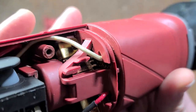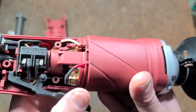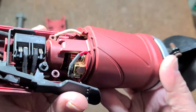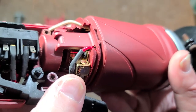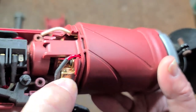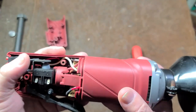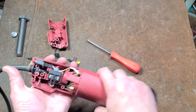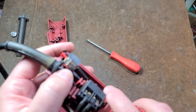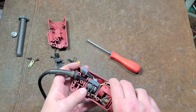The motor is not particularly great — we can see it has folded-over contacts. Brushes are pretty easy to replace and actually seem decent because it's an all-brass holder. They're just a snap-in affair, screwed to the body. As far as replacing the power cord, at least that's a standard affair with just a regular cord pinch and strain relief — pretty easy to deal with.